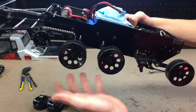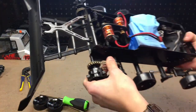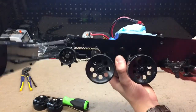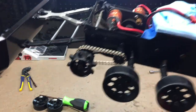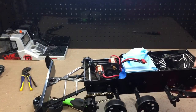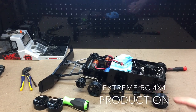So that's all there is to adjusting this chain tension. I have mine set pretty tightly, but I couldn't find anything in the manual or anywhere else that specified the tensions you want for these. I would just say be careful — maybe leave it a little looser to make room for if you get any dirt or debris in there. But I've also found that if you have it loose, dirt and debris can knock the chain off. Anyway, that's how you adjust the chain tension on the Kyosho Blizzard. This is pretty important because it gets really annoying when these chains start falling off while driving. After watching this, make sure to check out my video on how to set your track tension. Thank you for watching — please like, comment, and subscribe, and I'll see you guys in the next video.